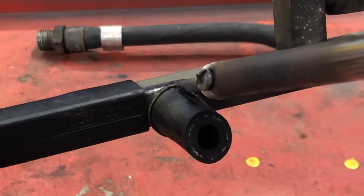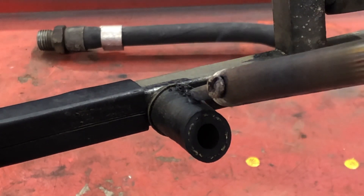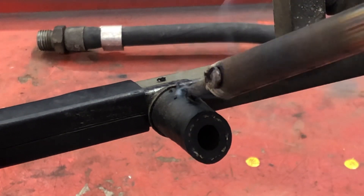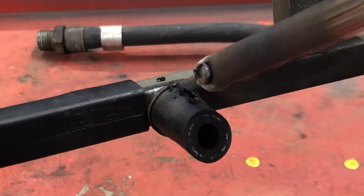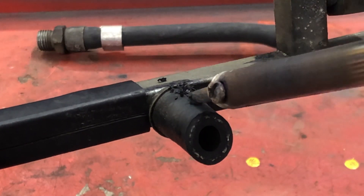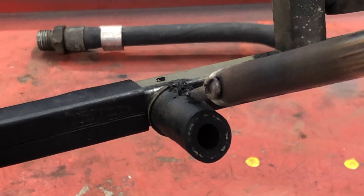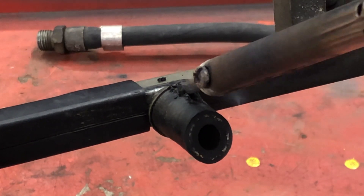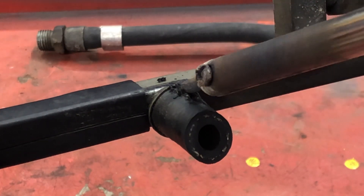Previously I always used a knife — I'd break off a nice sharp blade on an exacto knife. I have a reasonable feel for it because I'm only trying to cut it down enough to weaken the structure of the hose so I can get it off, but it's sometimes difficult. I never want to make a scratch in the fitting, because if we scratch the fitting it may not seal properly. Working on these things, we don't want to do any damage ever. I'm just running the iron back and forth and getting a pretty good channel in there.